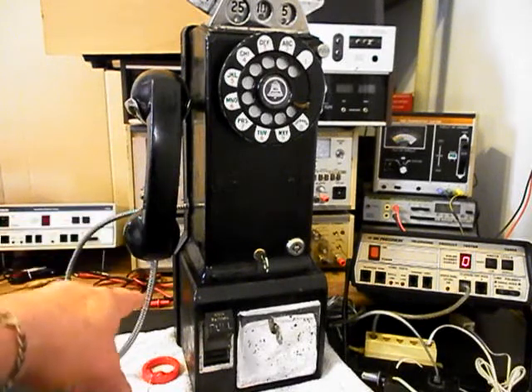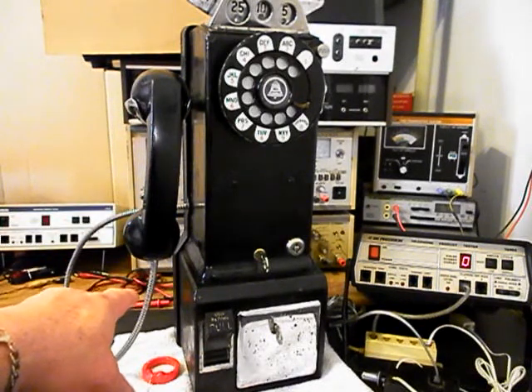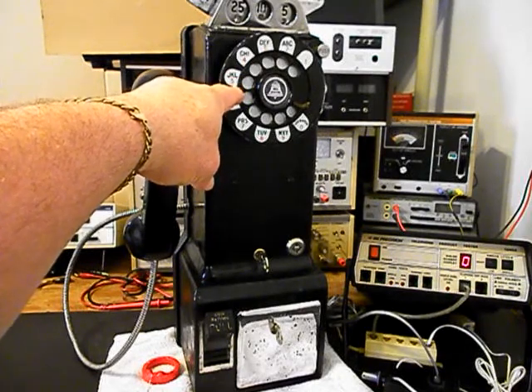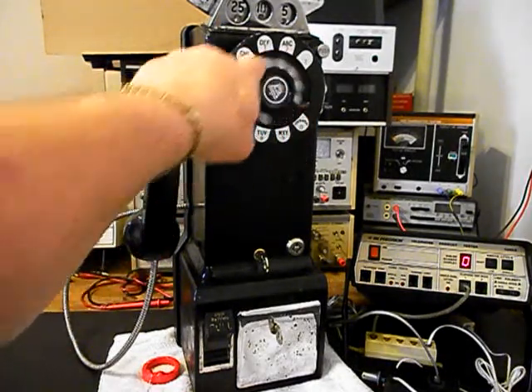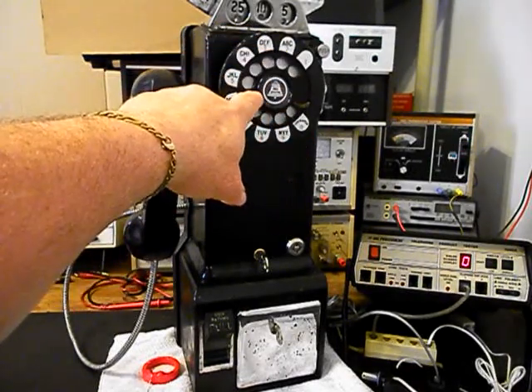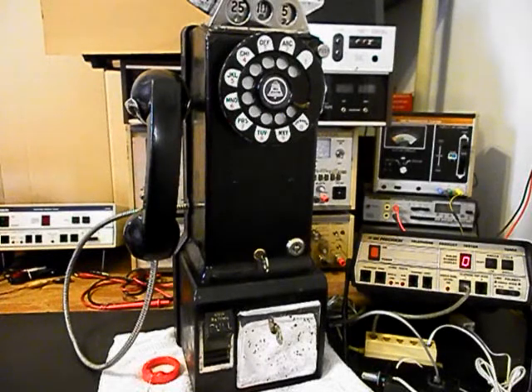The transmit was troubleshot along with our security cable. We also repaired the rotary — that was cleaned, oiled, and adjusted, and we have a nice smooth return on our rotary now. Merlin wanted a bell insignia for a center dial card, and that was installed. We also went through the coin validator and made sure all coins were falling through into the cash box area. We located a front cover lock and key and a vault lock and key.